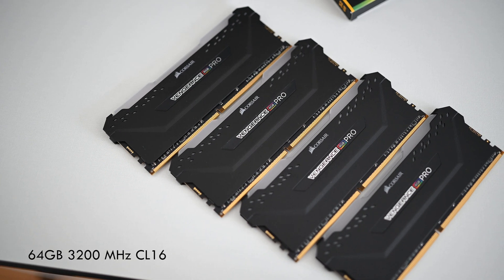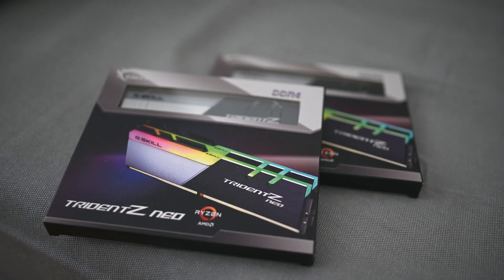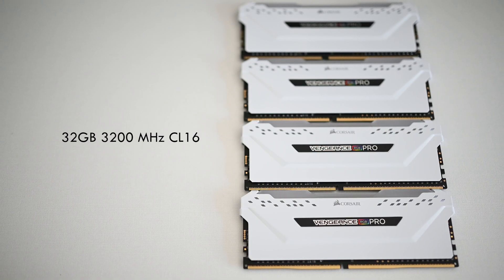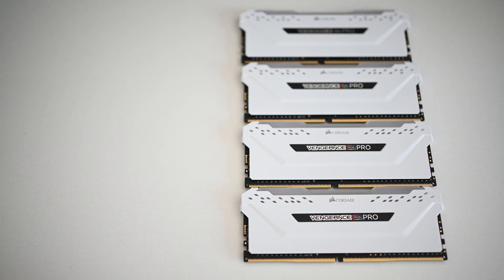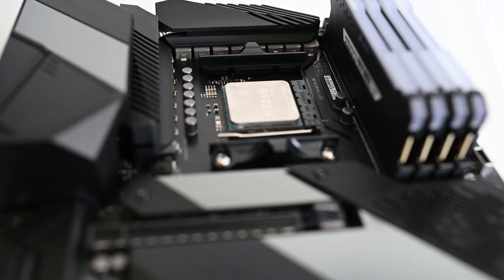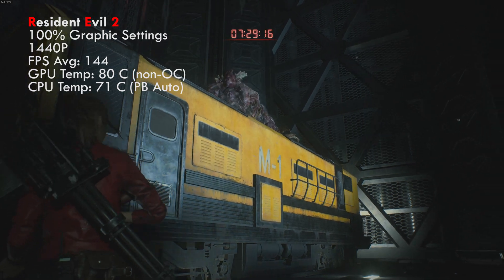While we're talking about the RAM, I've gotten many people asking and commenting why I don't use 3600MHz with Ryzen 3000. The truth is, I did actually have 3600MHz RAM — the G.Skill Trident Z Neo. However, I also had the 3200s from Corsair, and I didn't notice any real-world or significant difference. So I returned the 3600s to save some money and went with the 3200s instead, which I already had in my collection. I'm not saying the 3600 has no difference — there is, for gaming — but personally, I just didn't notice any.